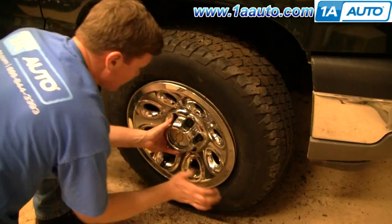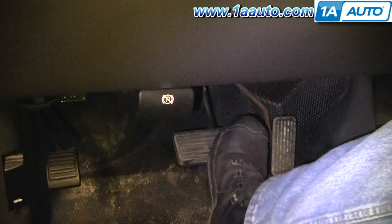There's one more step — after you do brake work, make sure you pump the brake a few times to get a nice hard, solid pedal.